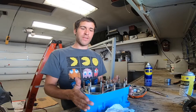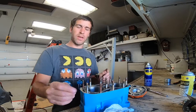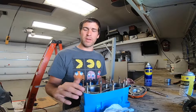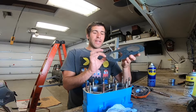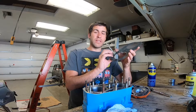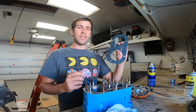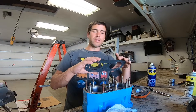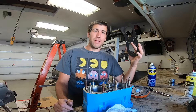It is the next day and I have cleaned up the cylinder, honed it out, cleaned off the surface on the head, and cleaned up the combustion chambers. In a couple of videos I said I was going to use a single layer of the head gasket — Yamahas had three layer head gaskets with one thicker layer in the center riveted together, and you could drill out the rivets to use just one layer. This gasket is only one layer, only 10 thousandths thick, and I'm removing 40 thousandths of base gasket. This will be taking me to 30 thousandths squish.